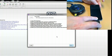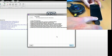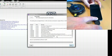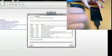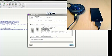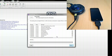There's the Apple logo. I'm now going to release the power button whilst maintaining the home button pressure, and keep pressing it until the extraction continues. So you can see the extraction process has started. So I'm going to release, let the finger go, and now XRY will start communicating with the device, and there we can see the XRY physical logo.